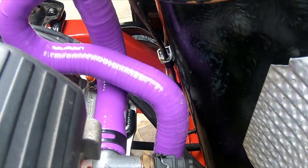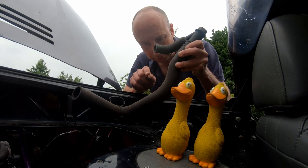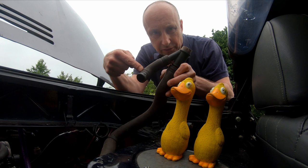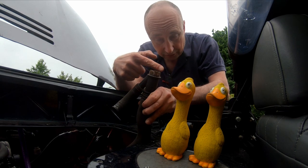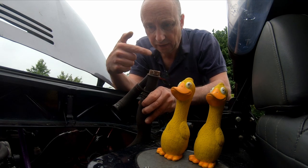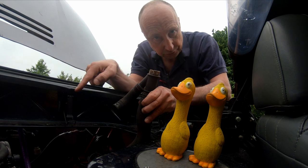On the VVC car, it's actually made up out of separate sections. This one's the original return pipe. So this comes from the return from the radiator. That goes to the heater. That which is cracked, this is the bit that actually broke back at the track last year. That comes up to the coolant rail and then round to the thermostat housing.